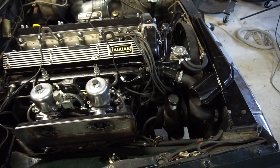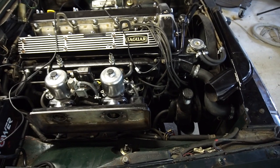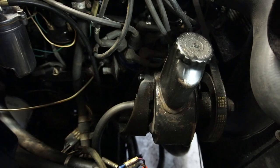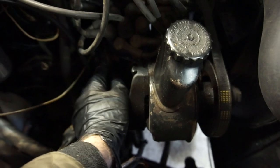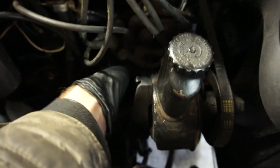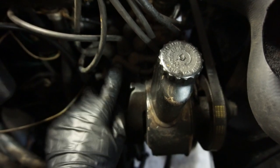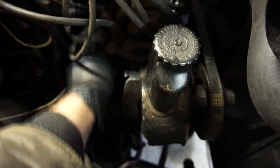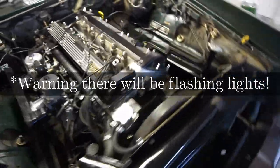On this engine, the timing should be eight degrees before top dead center. This is a Series 3 engine though, that has Series 2 inlet manifolds and carbs put on it. So it does have the Series 3 distributor, which is a great distributor because it's electronic ignition. However, if you have the original Series 2 distributor with points and condenser, on the other side of the vacuum advance you have a little knob called the vernier that you can turn back and forth. That lets you make small, easy adjustments to the ignition timing instead of messing with the pinch bolt at the back. I set this up roughly with the pinch bolt statically, so it should be pretty close. Let's fire up the engine and see what the timing is and if it has to be adjusted.